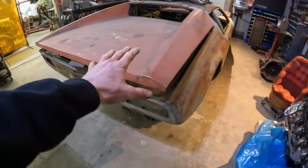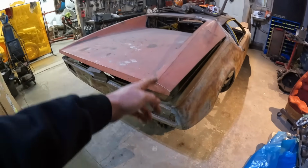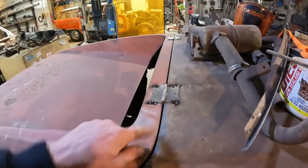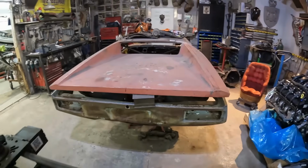All right. So maybe before I commit to that layout and bending the body this way to accommodate for the trunk lid, maybe I should just do an X and make sure that the trunk lid is actually square and it's not just that I'm basing everything on this gap. You know what I mean? Probably should have done that a minute ago. Either way, let's pull some measurements to confirm, and then we'll make another plan.